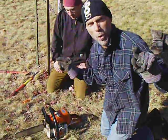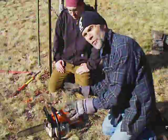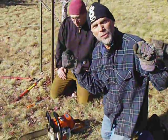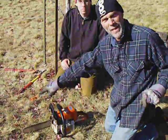Anytime you have a 2-stroke engine, especially a 2-stroke, but any engine, if you think it's flooded, you've got nothing to lose by going full throttle to see if it's flooded. It will clean out and start up like that just did.